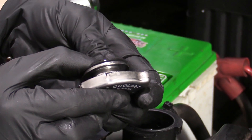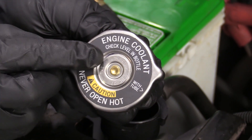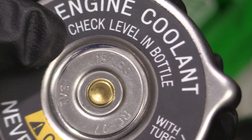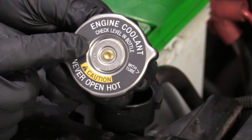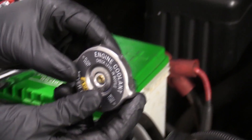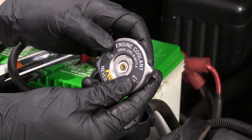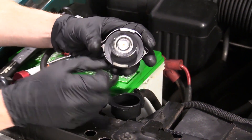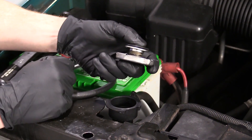You'll also notice a little pressure relief on the cap — that's for venting. It has a number that tells you how many pounds of pressure it's supposed to hold. Once you build up too much pressure inside the system, it's supposed to vent. If the spring gets weak over time, it's probably going to vent at an earlier stage. This cap is supposed to hold approximately 15 pounds before venting — maybe it goes at 12, maybe 9, or it might just leak as soon as you start the vehicle. You'd want to test it with a pressure tester, or just replace it — they're fairly cheap.